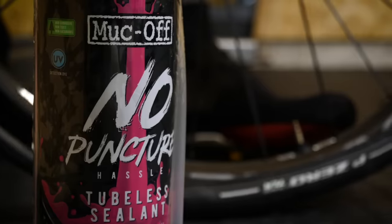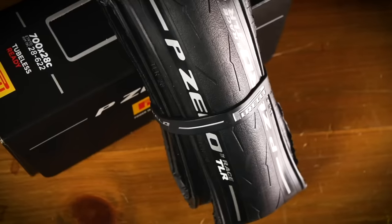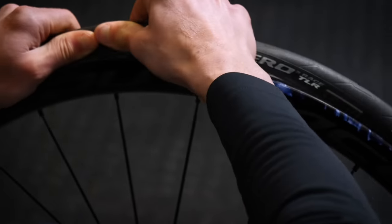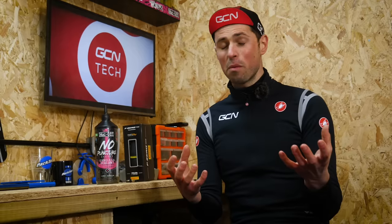What if you want to switch to tubeless? Most mid-range and upward bikes include wheels and tires that are tubeless ready — they just tend to have inner tubes fitted when shipped. It's also often written on the wheels and tires themselves whether they're tubeless compatible. If you can't see it, head down to your local bike shop and they'll advise you. You'll need some tubeless sealant, a tubeless-specific valve, and obviously a tubeless-specific tire. Setting up a tubeless tire is actually a fairly simple and straightforward process. If your wheels and tires are not listed as tubeless compatible, don't try to make them so — you run the risk of your tire going detached from the wheel, and nobody wants that.